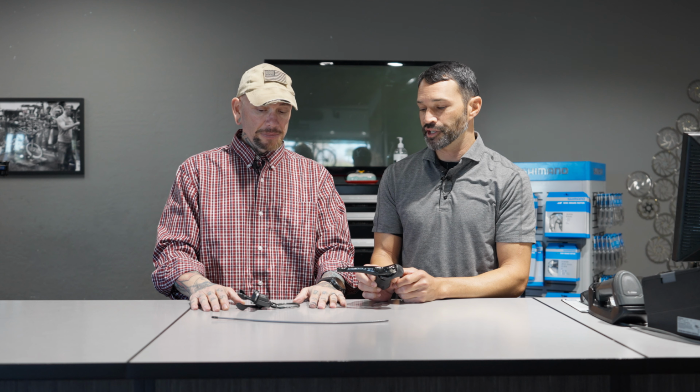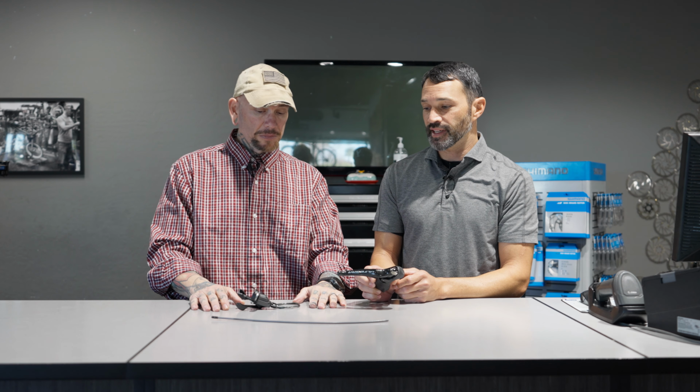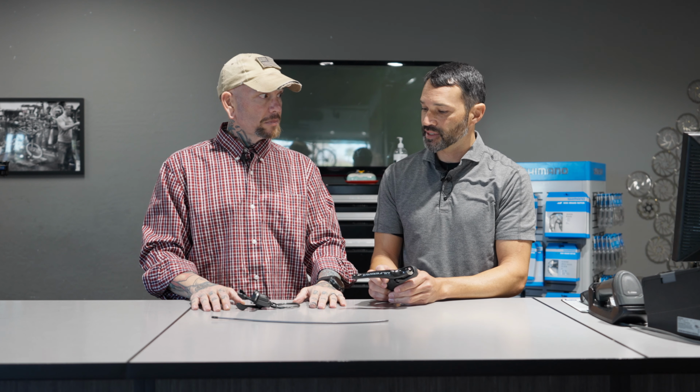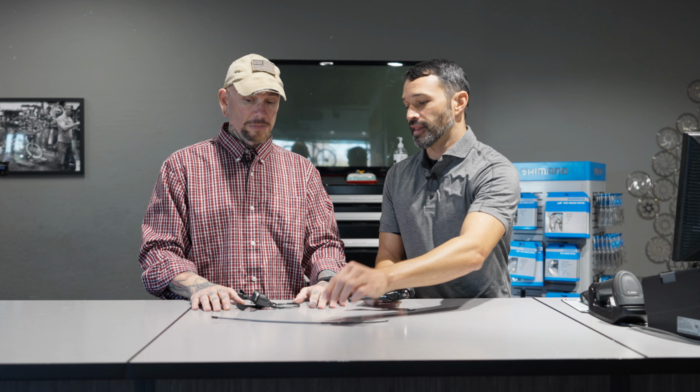I would say we can do a little bit of adjusting on the barrel on the mountain shifter. These guys don't have a barrel on the mechanical ones, but typically there's a barrel somewhere else on the bike that we can adjust the cable tension. What's more important is the way we maintain the actual cable and housings themselves. And that a lot of times is just keeping the thing clean. Conditions are really what compromise the effectiveness of how well these things work.